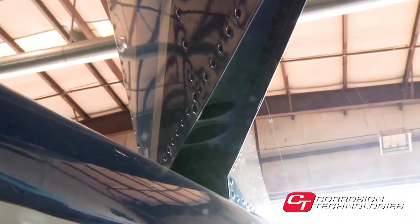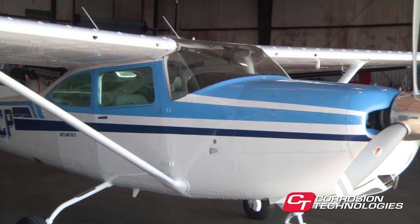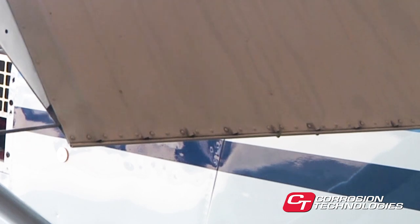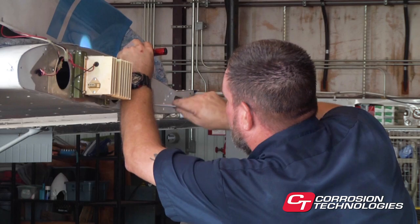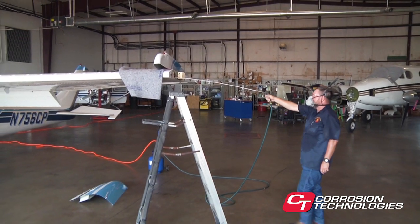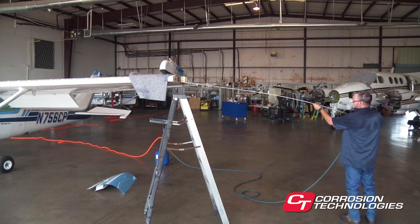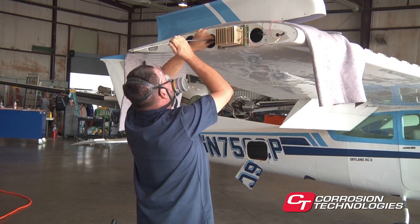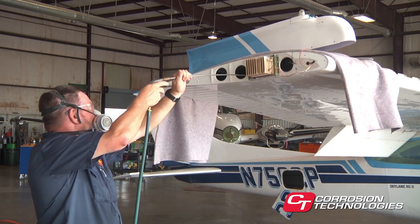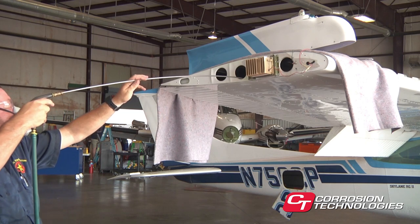After treating the fuselage, let's move to the wing and tail. We mentioned the reason for working from the bottom up — this is especially true with high-wing airplanes. You can expect some dripping, and frequently your customers will want to see it. Both for environmental consideration and to keep your hangar tidy, it's a good technique to lay some plastic under the aircraft to catch the drips. Wing and tail application is essentially the same. For this plane, we have attached the eight-foot by quarter-inch diameter wand to the spray gun, and we have removed the wing tips to access the interior of the wing. Insert the wand, usually through a lightning hole, as far into the wing as possible. You may find it easier to remove the wand from the gun, insert it into the wing, and then recouple it to the gun after insertion. Pull the trigger and slowly walk backward, pulling the wand out. Repeat the process through each lightning hole.